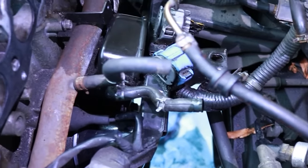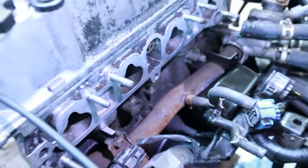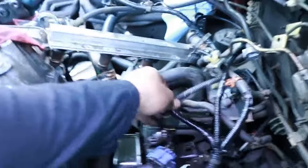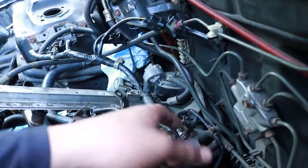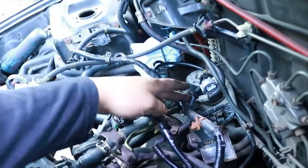Tuck everything and pull it out — it's pretty simple. You're gonna have to extend two hoses: one's a quarter inch, one's three-eighths. There's also a PCV valve to swap. Extend the hose maybe two to two-and-a-half feet each. While you're down there, clean things up wherever you can. You'll have to extend some wires and do some mocking up — there's gonna be tape and some wiring skin to unwrap. You'll end up with one extra air intake harness on the side, but everything else should plug up.